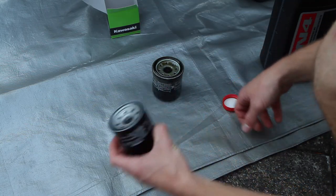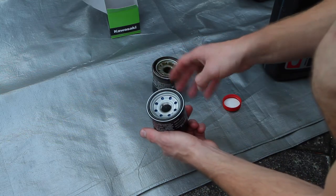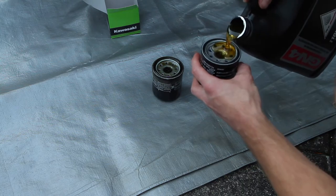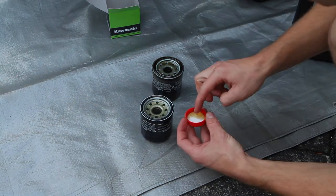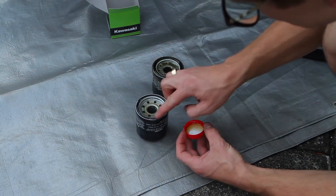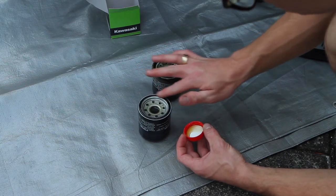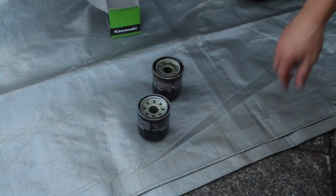On this bike, since it's a horizontal application for the oil filter, we can fill it up partway — I'm going to try to get about half of the oil filter full so we don't have to prime as much when we start the bike. This filter came pre-lubed, but you want to make sure the o-ring is lubed around the seal so that when you tighten it down it can slide and spin with the filter and doesn't bulge or warp. Some lube around the seal is good — now we're ready to put it on.